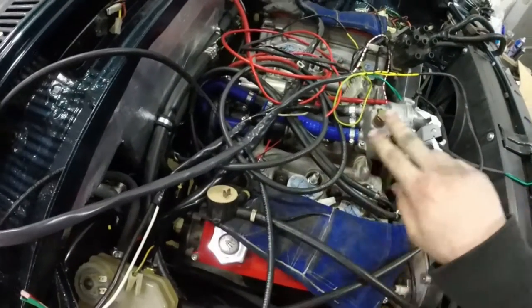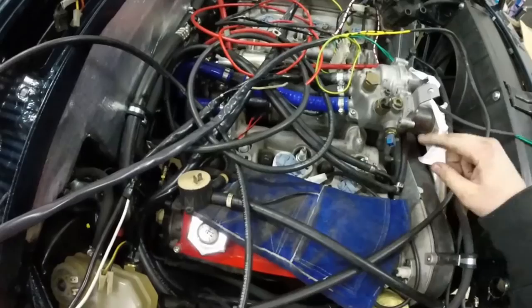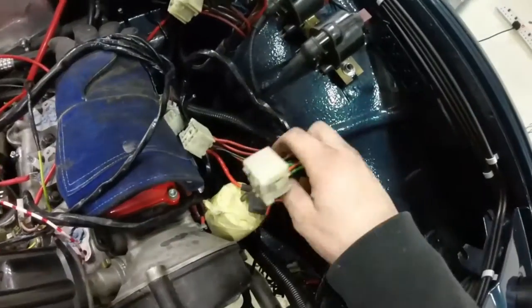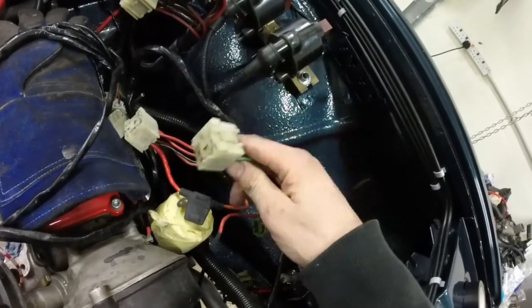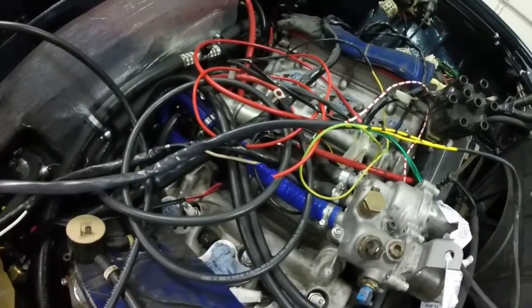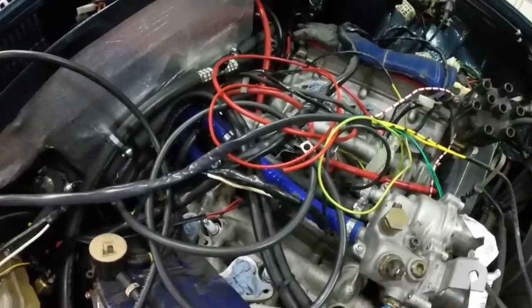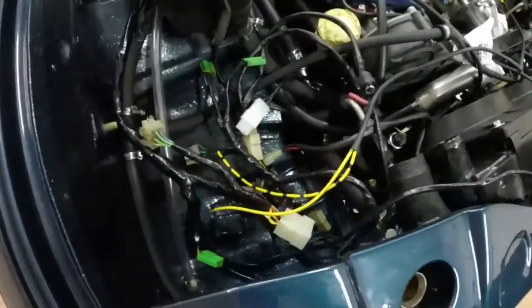Now since the Type A and Type B relays are not interchangeable, because of the way the coil is positioned, terminals 30 and 86 were swapped to accommodate the new relay, and the positive terminal was fused. Also, most of the old weird wiring was properly rewired and repositioned. The old wiring had some positive and negative wires which were marked in the same black color, so the positive wires were changed to red wires and rerouted to the back of the car.